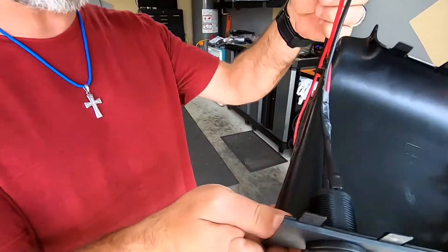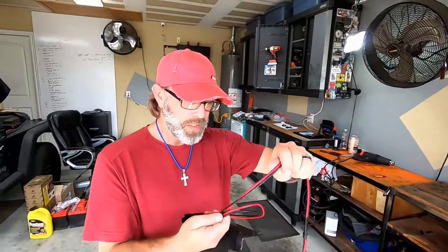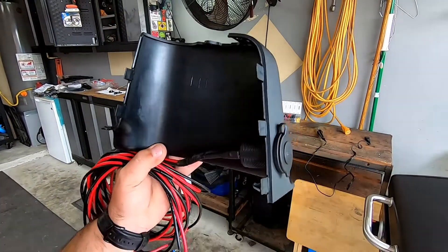We did a little bit of braiding down the line and added some tape, primarily because when you make modifications to the Jeep and wires are running through door channels, you don't know which wire is which. This is about 15 feet total. Where we put that 12-volt plug is going to be just shy underneath the seat belt — it's gonna be up tight and out of the way. Fitting it right in between the two lips and clips works out really well, and the seat belt sits just slightly above it — it creates a nice clean install.